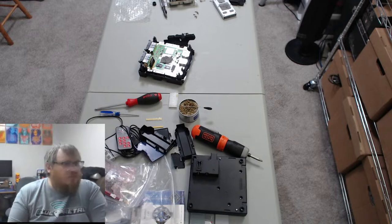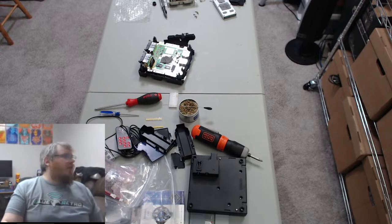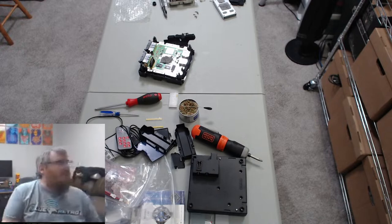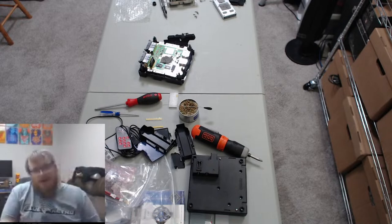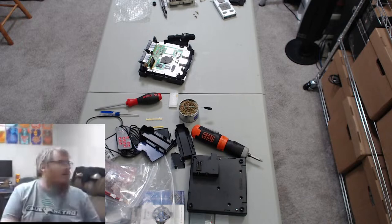All right, so I held the button down, plugged it into my computer. It showed up as a USB device. So let me grab... Greg dropped the links and all the descriptions here. Yep, so the picoboot.uf2, you just drop it onto the Raspberry Pi, or Pico, and it'll install the firmware. And once it's done, I think it flashes the LED or something and comes back on. Okay, so after moving it to the Pi, it'll disconnect itself.